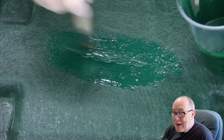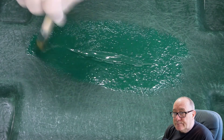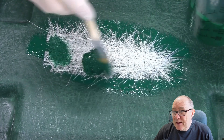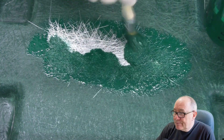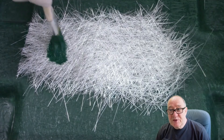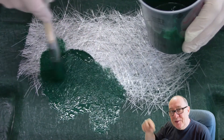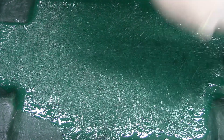Then we're going to apply a layer of resin around the affected area. Now we're ready to add our first layer of fibreglass — just put that down and then stipple more resin into the glass strands until they are thoroughly wetted out. Then we're going to repeat that process with subsequent layers of matting; each layer needs to be about two inches bigger than the previous layer. Give the repair a good heavy stipple to remove any air and leave that to cure.